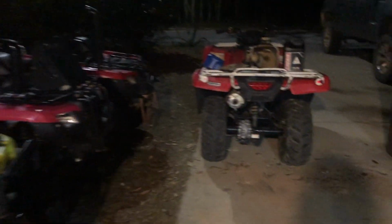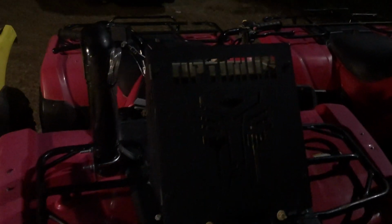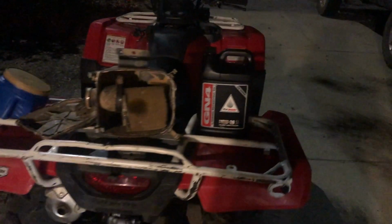I forget which bike I left off on, but finished the top end on this one. I forgot to record after that. Finished the top end on this one. Got this motor pulled out. Did the front and rear covers. Fixed the timing chain issue, which if you follow me on Instagram, you would see that timing chain fell off. Literally just sitting there in the front cover. So that one's fixed.